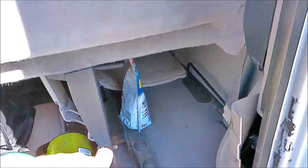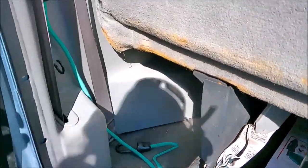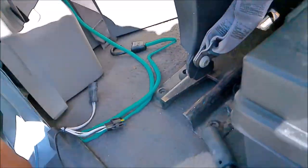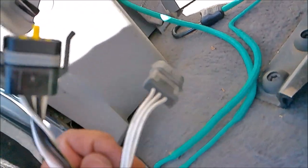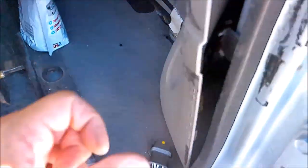I have the rear bench seat in my van so I just unlatched it and moved it forward a little bit. You're going to take out some retaining pins, pull the weather stripping, and push it forward a little bit so you can slip the wiring harness through. On the passenger side it's just the jack storage, so that part's easier.